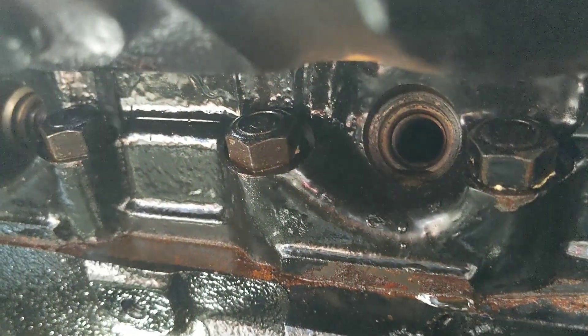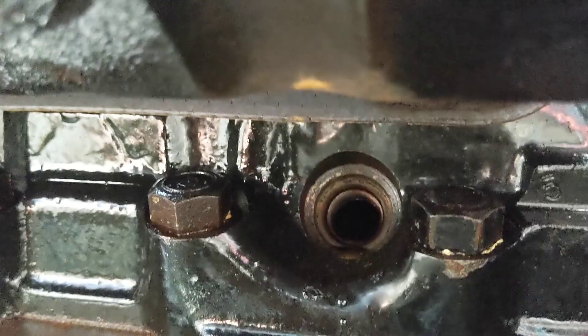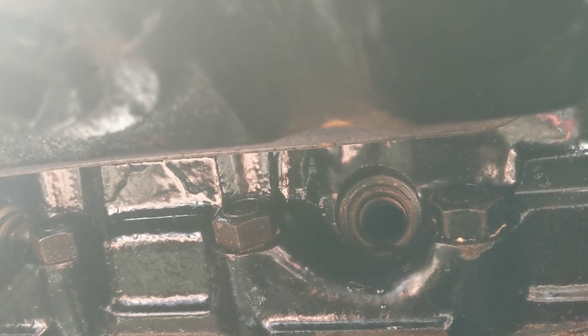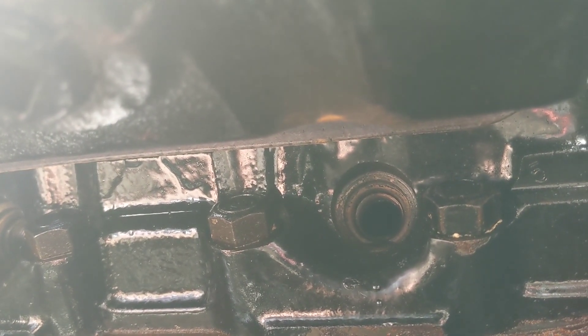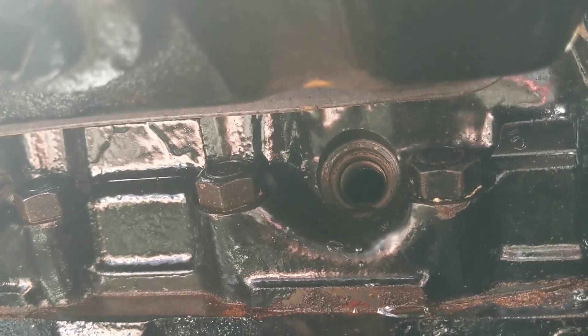So that back one is not good. Because of the way the plug is kind of angled up, and this right here is the manifold — that little groove is just not working for me there. So I ended up getting an offset wrench — a double offset box-end wrench is what they're called — and that worked for these two plugs.